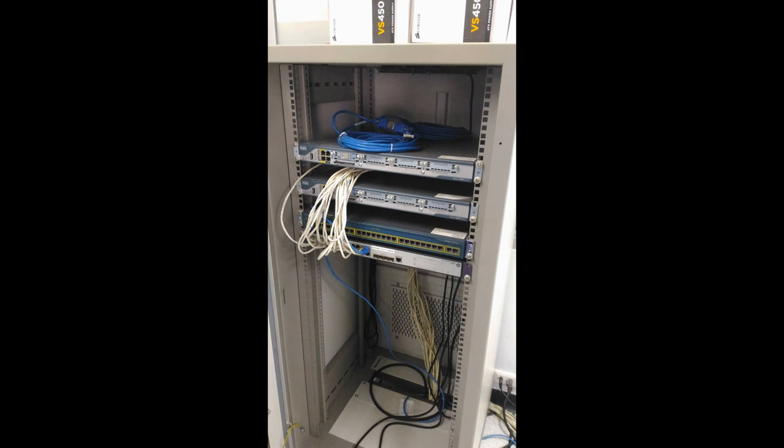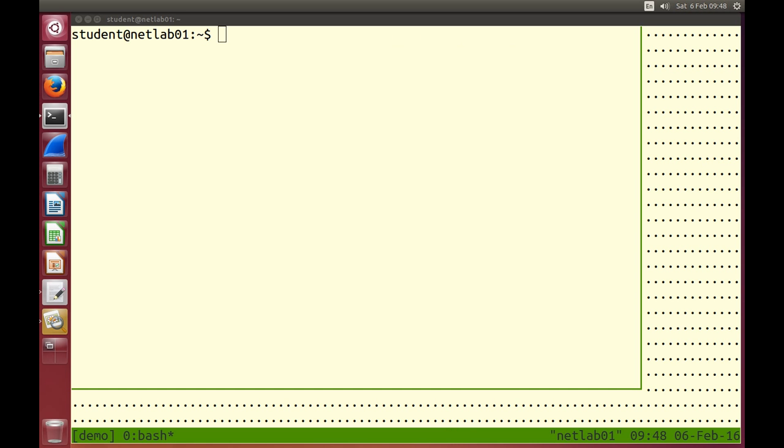That's a switch, all right, so that's a network switch. The cables from the computers plug into that switch, and then that switch has another cable that goes upstairs to a fifth switch. All four of these switches all plug into that fifth switch upstairs. Then that one connects out to our router for SIT and then out to Rungsit and then out to the rest of the world. So that's the topology of the network.